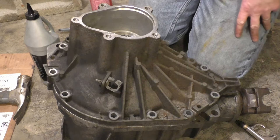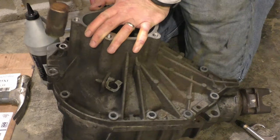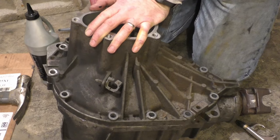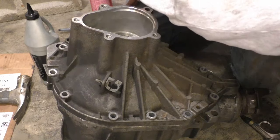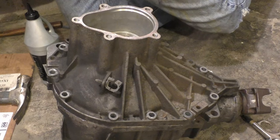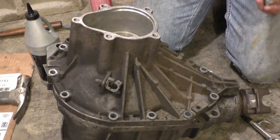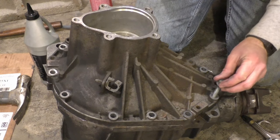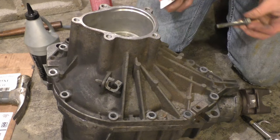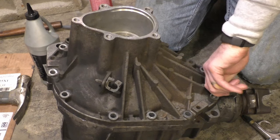Take a little brass hammer, wherever that's at. Tap this down. Okay, time to put the bolts in. I'm gonna use a little bit of thread sealant or thread locker. I just happen to have some Permatex stuff here in the shop. I'm just gonna add a little bit to each one. Doesn't need to be anything crazy. Get them started, then I'll tighten it down